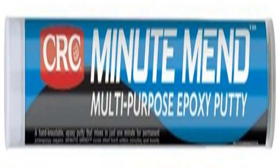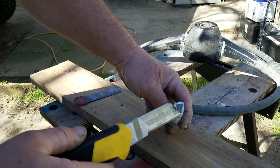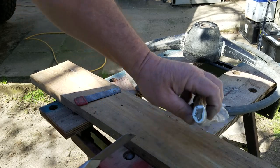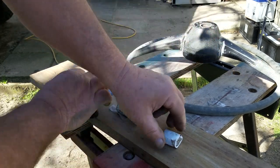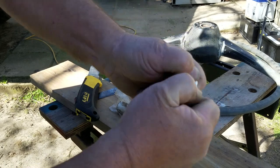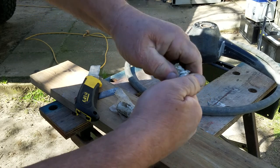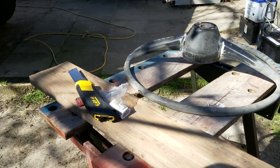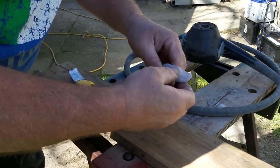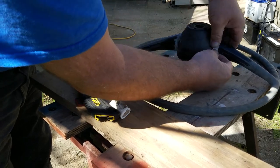What I'm putting into these cracks is an epoxy paste — very stiff, and this one's the waterproof version. It's roughly 50-50 two parts. You chop off a piece and spend some time mixing it together. It's a bit hard until it gets moving and you do need strong hands. Mix it up until it's all one uniform colour, then paste it into those deep cracks. I'm going to overfill them slightly.